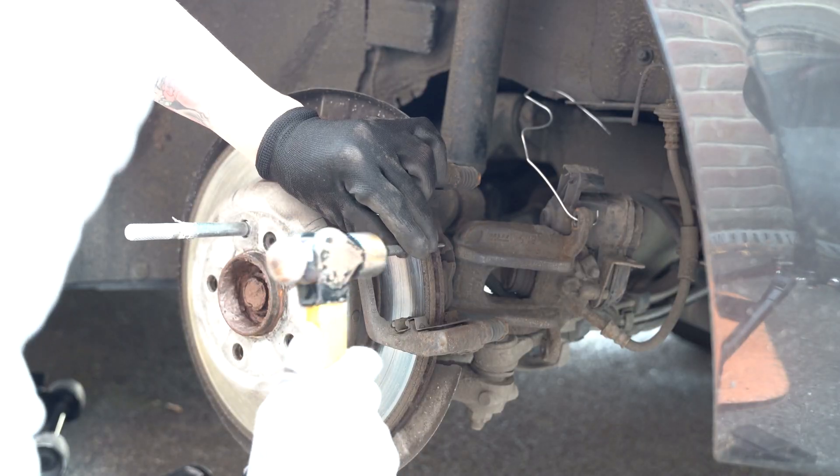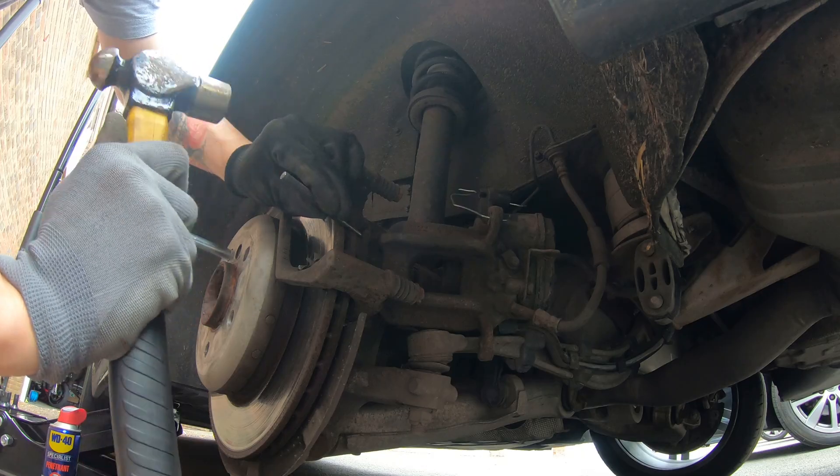Why is it happening? Your brake pads are getting stuck in the holder that should be allowing for that movement to happen, and due to corrosion, the inner brake pad is getting seized in the channels that should allow it to move. Add that to brake pad servicing that hasn't used the correct chemicals and the correct attention to clean those surfaces, and any older BMW will be experiencing this type of issue.